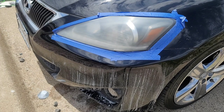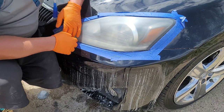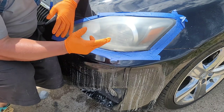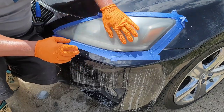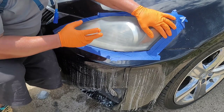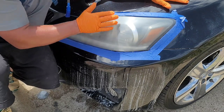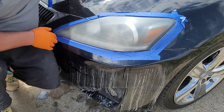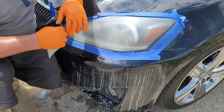We've already done pretty much all the extensive process to remove the oxidation. Now we're in the phase of finishing the sanding — then we'll polish and apply a ceramic coating to finish it off. Quick tip: as you're sanding, you should be getting clearer results. You saw a lot of that browning earlier — as you go up in grit numbers, all you're doing is going over the previous grit and finishing it out smoothly, removing the marks the previous sanding left. The outcome is a clear headlight. We were at 2000; I don't have 2500, but we're jumping to 3000.